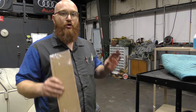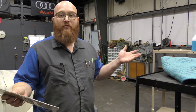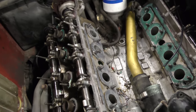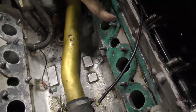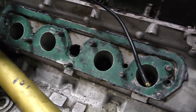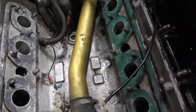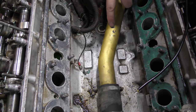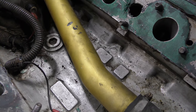The nice thing is there's no corrosion on the cylinder heads themselves - I'm so happy. I was worried it would be something really bad, but they're perfectly flat. We started removing the silicone they used to seal it up, and there is no corrosion here - it's nice and flat. There's some green residue left from the gasket, but the gasket is gone. No corrosion - the heads are perfectly fine. I will be replacing this coolant pipe because it looks like a vacuum line was laying across it, and that rubbing is pretty deep. I don't trust that - I don't need it to spray antifreeze everywhere.